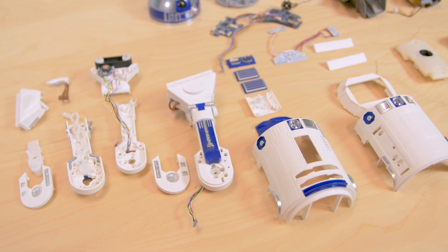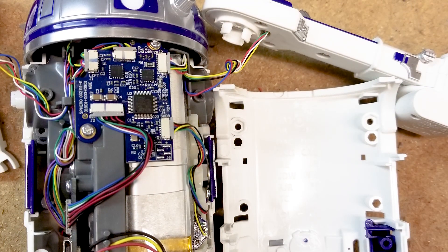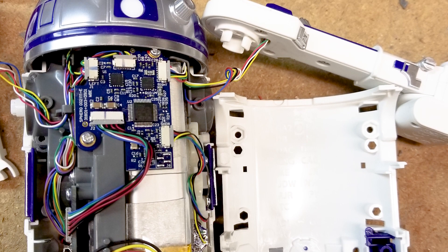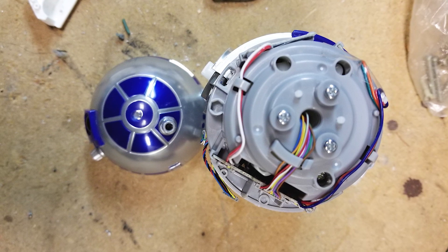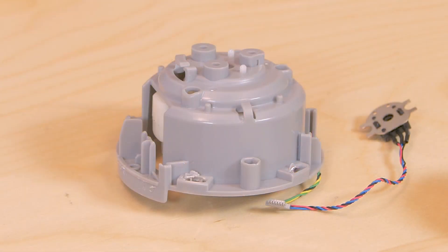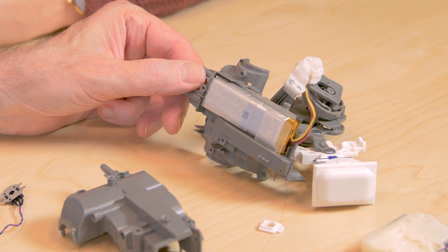Once the arms are off, you can remove R2's main body panels. The cover for the cylindrical part of the body is in two pieces. One piece is held on with a couple of screws and comes off pretty easily. The other cylindrical panel only detaches after first removing the top dome-shaped cover on R2's rotating head. The dome cover comes off by rotating the head to get at two snap fits. The snap fits are rather tough to manipulate, so because our R2 wasn't going to be reassembled, we dremeled the snap fits off to remove the dome cover. Once the dome is off, the other cylindrical side panel comes off to reveal the speaker and lithium-ion battery underneath it.